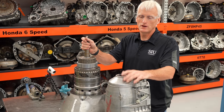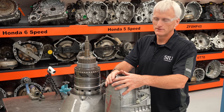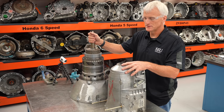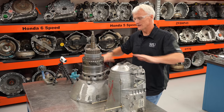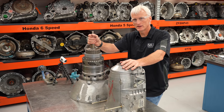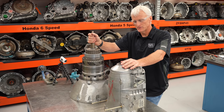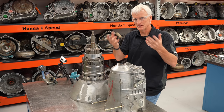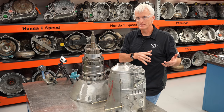For this video I'm going to pull the B3 clutch, B2 clutch housing, and associated parts and take them apart, then put them back together, even before getting into the rest of the assembly. In the real world you'd disassemble the whole transmission, clean everything up, inspect it, order parts, and then build. Here we're doing it differently for training purposes — as I take something off, I'll disassemble it, talk about it, reassemble it, do the measurements, and then move on.